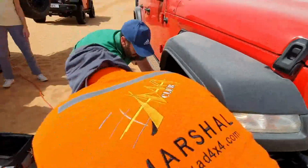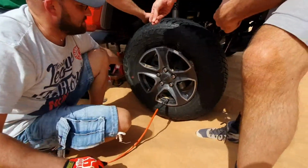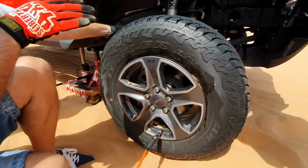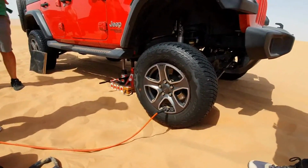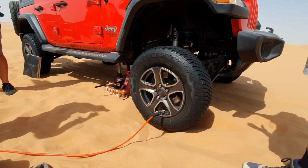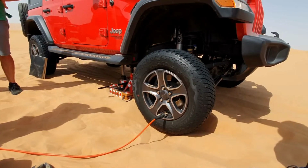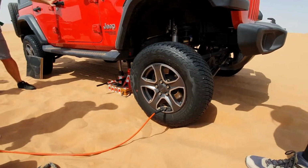So what you can hear is now, after that initial seal was formed, that'll pop. You stand back, take your fingers away. Now you can see here already that it's starting. Stop and pop the tire back out. Alright, so then the next thing, here in the background, it's called the bead of the tire. It'll pop back on the bead and lock in a little ridge, so you'll see in a couple of seconds it pop back on, and then we want to air it up to 40 psi to make sure the tire's on really well, and then we'll air it back.